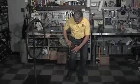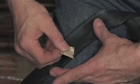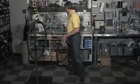All right, and you can see where the two lines are, so that means the hole is somewhere about right there at the corner of the paper. So you're going to just get your sandpaper and just rough it up a little bit. Now you can see how the tube is getting a little bit lighter in color where I'm sanding. That's your key that you're getting it clean. Just lightly blow the dust out of the way.